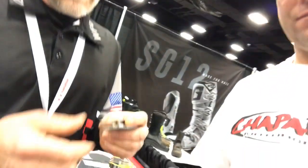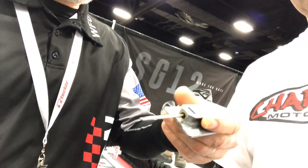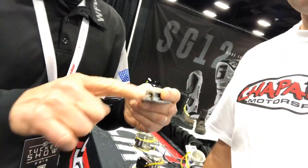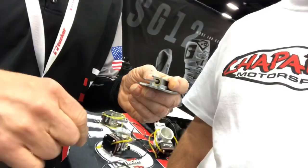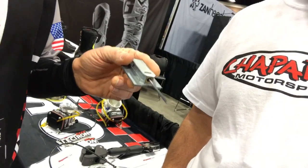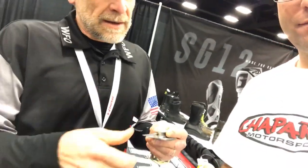That's number one. We have a metering rod that is flat on one side — a conventional rod is round. This metering rod is programmed on a CNC machine and a dyno. We can program it like fuel injection: we say it needs X amount of fuel at quarter throttle, half throttle, full throttle. We program that in and the CNC makes this metering rod. That's how we tune for the bikes. There are different meter rods for big or small applications, and four-strokes and two-strokes each have their own meter rod.